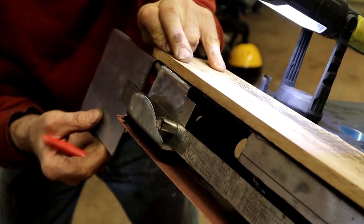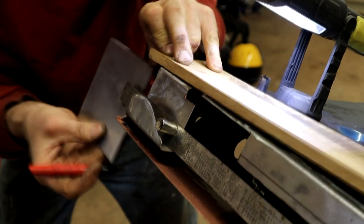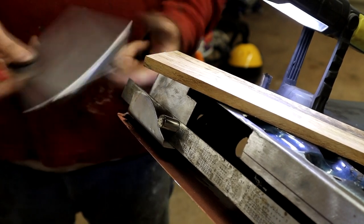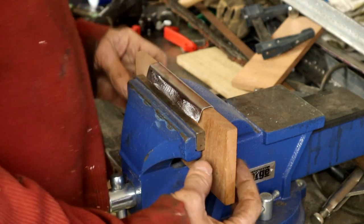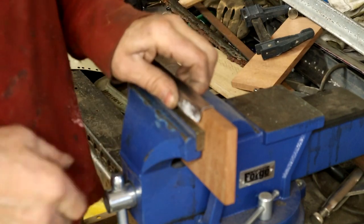Tells me where that is, you see. Then we can tell where the bottom of that flange is. Then we can make our bend along there, you see. I've jumped ahead a little here. I'm working on the second patch, and I'm working to fold the final inner channel flange here.